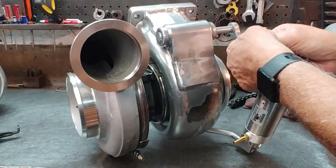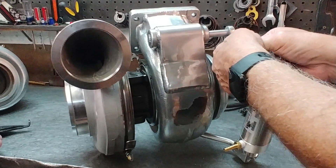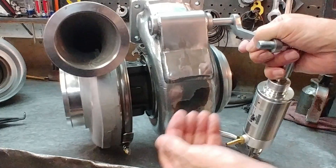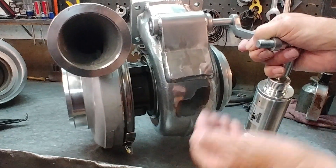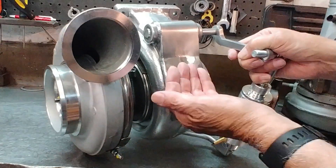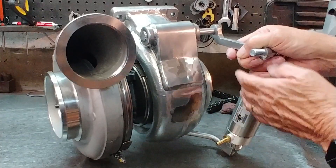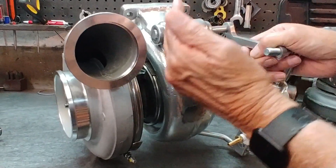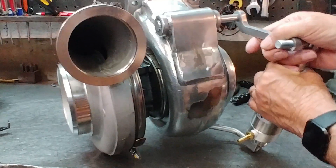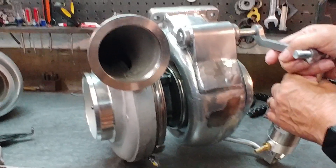If you see it slobbering oil out of the compressor housing or back in the turbine, you know you've got a problem — it's not draining fast enough. It's either not vertical enough to drain as fast as it should, or you've got a lot of crankcase pressure coming back up and not letting the oil drain fast enough. Either way, you have to address those situations. If it's just because it's not sitting straight, once you straighten it up and run it, it'll dry up and you'll never know it again.